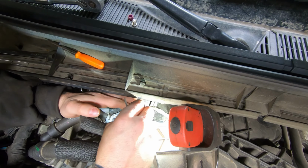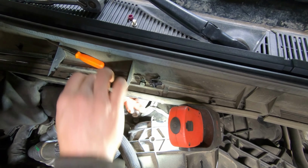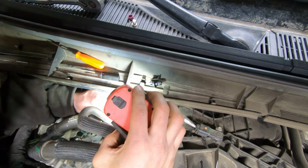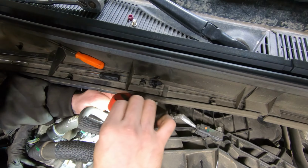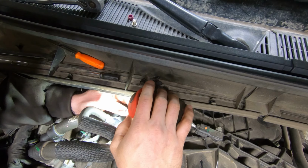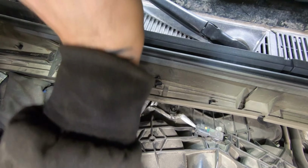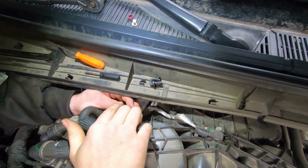Alright, those are open. Pull it wider out. Yeah, these terminals are a little open, so I mean that might have been my problem. But so I guess if you want to mess around, you can take your connector apart first and look in there. Try to show you, but that camera doesn't get very good up close things. But I just look in here, and there's a little tab that goes down, and this should be kind of touching, I'd imagine.